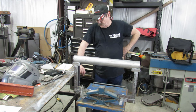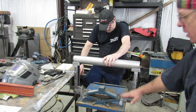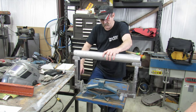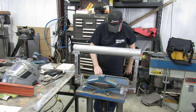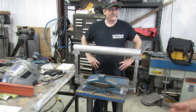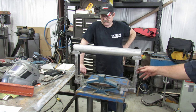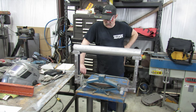We've got it all cleaned up. This is a lift table that goes from 30 up to 48 inches, so we made this just enough rise to clear the pumpkin and work with the lift. It wouldn't work as well if your car is on jack stands, but you could do a similar setup with jack stands and a floor jack to get everything set right. We have a couple of other jobs coming up in the next six months that will also require setting pinion angles, so we decided to build the tool. If you can build a tool to make life easier, it's good — especially if you're going to use it more than once. Work smarter, not harder.